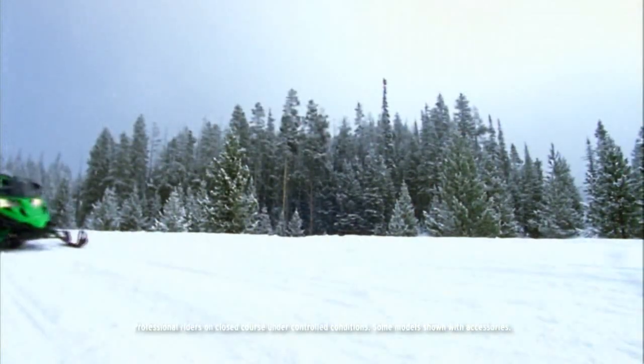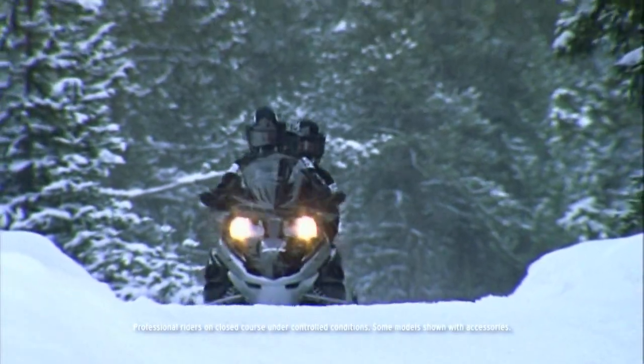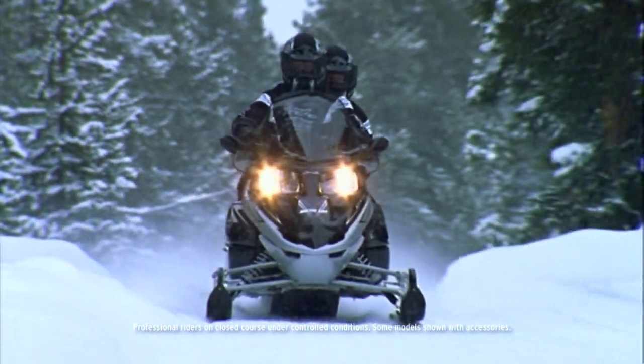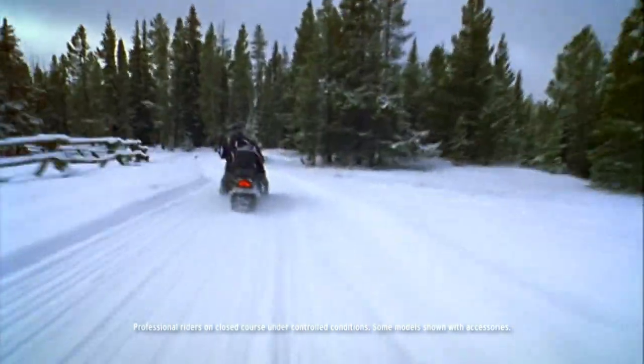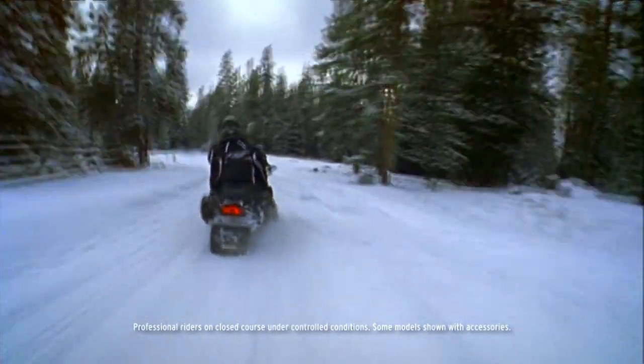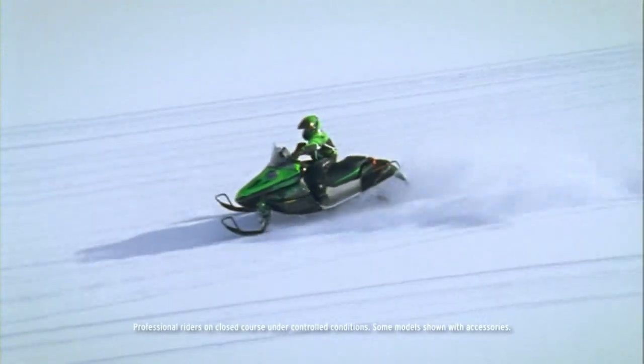The ISC control is really unique for Arctic-Cat. We developed it initially with the T660 as a mechanism to control the idle throughout the engine's life. It compensates for engine wear, but through our development process we realized we could use it for other functions. One of the primary functions we used it for was to reduce the amount of four-stroke engine braking when you decel the snowmobile.